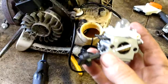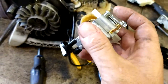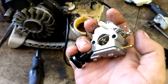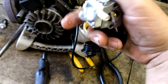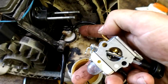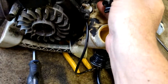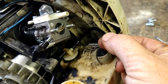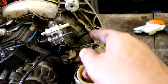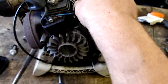On this carburetor, the nipple closest to the fuel pump is always the one that goes to the fuel filter — that's the fuel pump side. The other nipple over here is the return line; it goes back into the tank. The brass one points this way, so go ahead and slide the carb into place to get an idea of how long to cut the fuel line. Cut it to size — the short one is the fuel filter line that goes on the bottom nipple, and the long one is the return that goes on top.